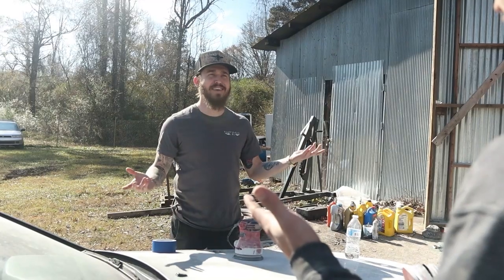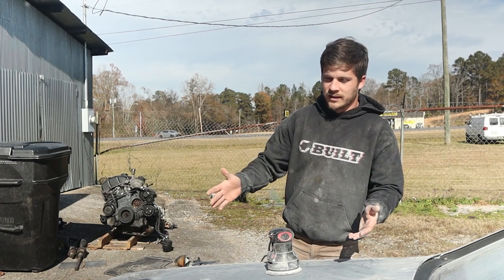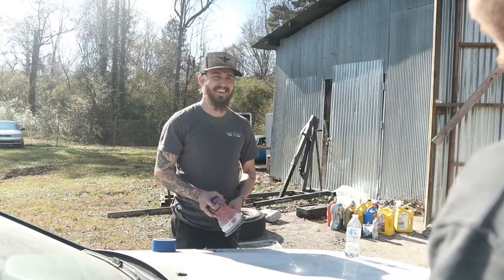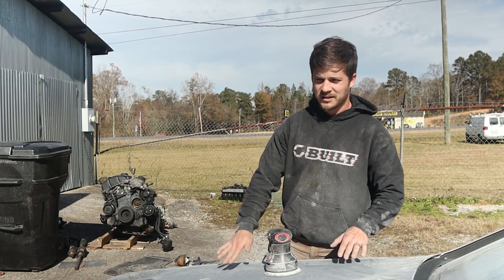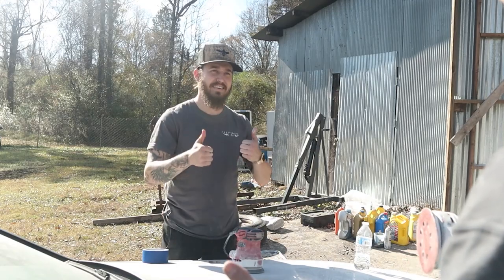All right, Eric. Why are you yelling? This is what we're gonna do. So we're just gonna knock everything down. We gotta make sure that this thing's not shiny at all so that the paint will actually stick to it. So we got 120 on these sanders, these orbital sanders. The only rule here is keep the sander flat. Okay. And don't hit the edges. Anywhere where there's like a raise, like in the hood, don't touch them. We'll hand sand that stuff. And that's really it. We're gonna hit the whole thing. Once the whole thing's hit, it'll be ready for primer and we'll be good to go.